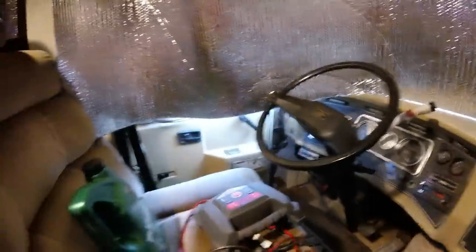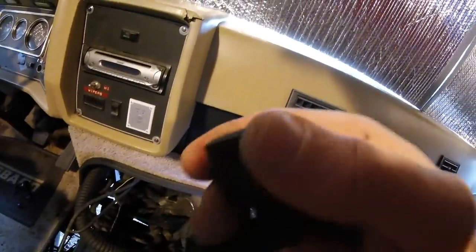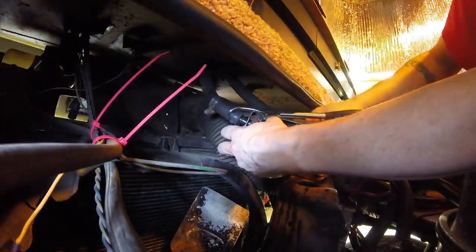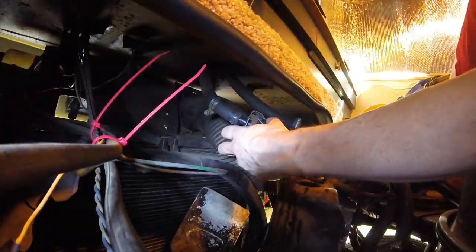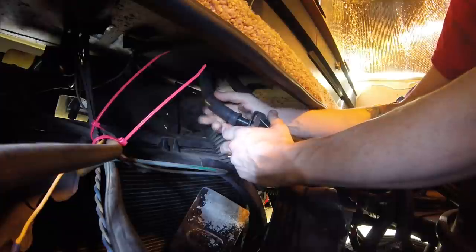Until I get a new vacuum-controlled coolant heater valve, I'll just put this in right there. It might be okay with the fan as long as I keep the fan off — in the summer I usually drive with the window open anyway. I'll just keep an eye on it, make sure this thing doesn't start leaking. Taking out that leaky valve — finally one of these hose clamps is coming in use. These hose pliers, I got those like two years ago and never ended up using them — finally came in handy. This hose was not gonna come off by hand. Got it, no problem.